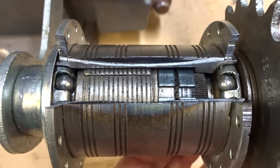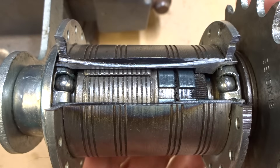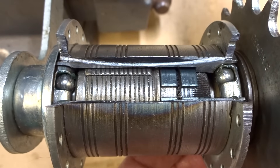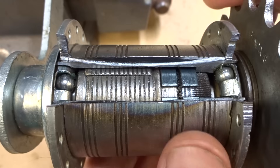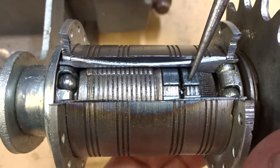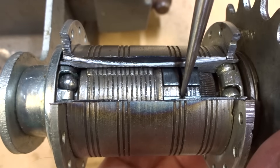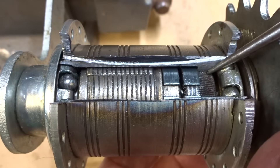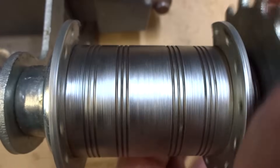Now watch as I go to pedal forward. Watch the spring relative to this little notch right there — that little lip — and watch the clutch. So the first thing that happens as I go to pedal forward is this whole part here is going to get pulled over to the right until the spring hits that little lip. The spring will stop, and as I continue to pedal forward, the clutch will slide a little bit out of that spring. There are teeth inside the clutch and the expander — they become disengaged, and these little splines here become engaged with the inside of the hub shell. So now as I'm pedaling forward, the wheel is turning forward.